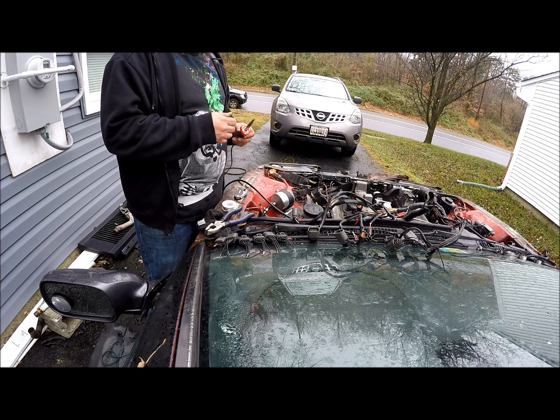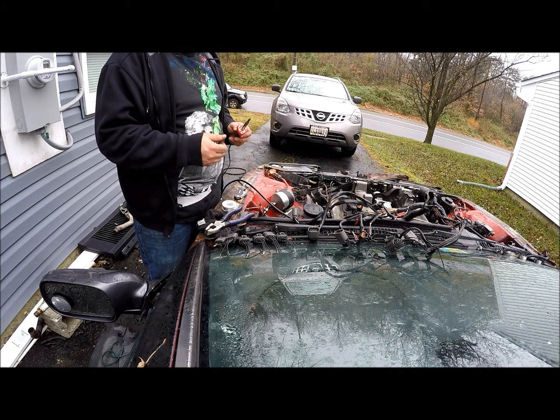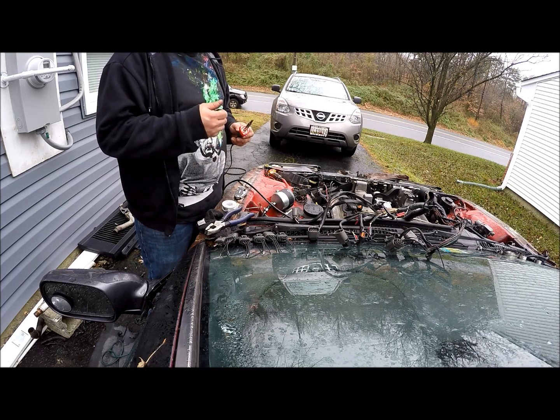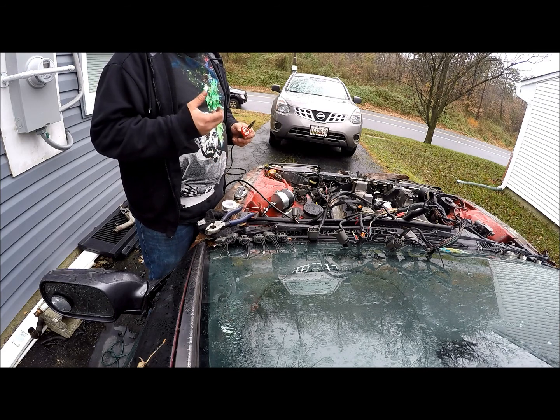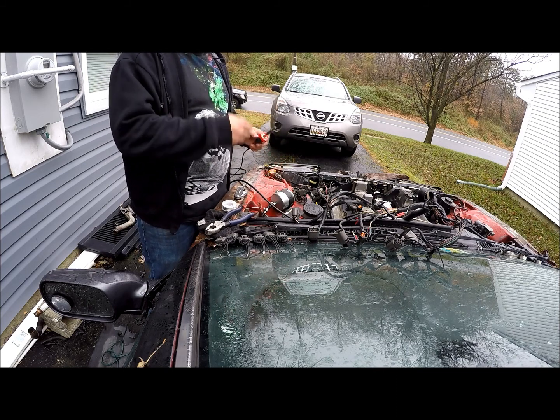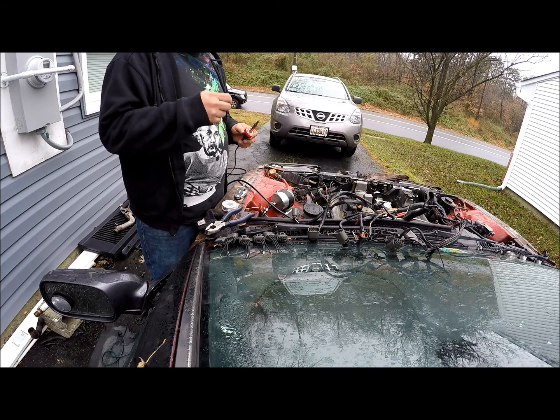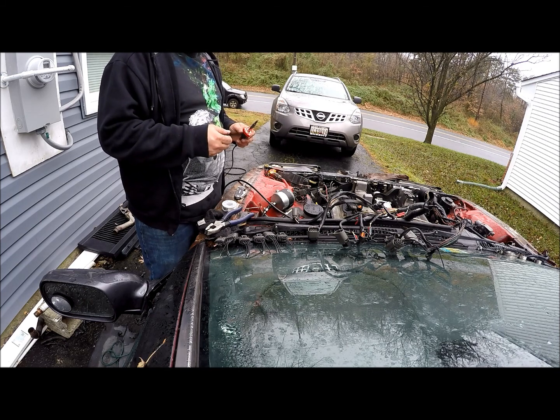When the wire starts to heat, what you really want to do is tap the solder onto the wire, not the iron. And it should be hot enough to flow, which means it's going to fill all the gaps between the wire. So I stick my wire in there, I dab some on the tip, wait until I see it start to flow, and then I dab it on all the other spots in the wire.